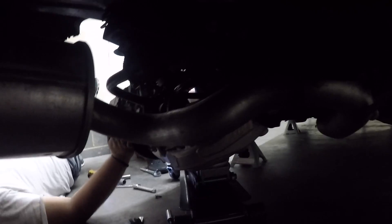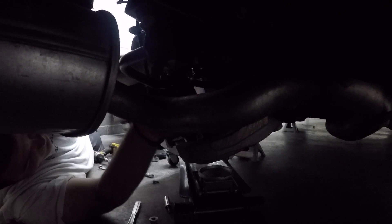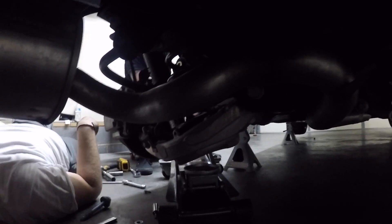Here we are under the car. Chris, you don't want to use the impact? You had to take out this bolt and that bolt right there, plus a bolt in a different area, and that will drop all this down to get the spring out. It's coming down now actually — let me back up. With a little love and affection we'll get that back up. That's the gist of getting these off and getting the new one on.